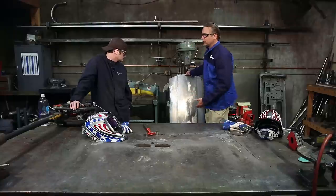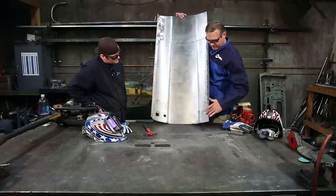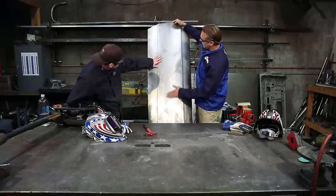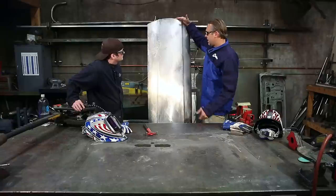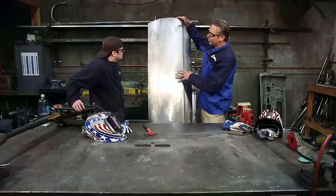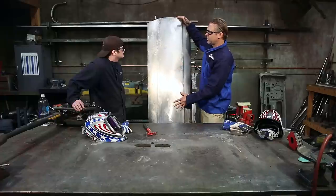Now that I've shown you the basics on TIG welding sheet metal, I'm going to show you a product that's almost finished so you can see what it turns into. Right here I've replaced a patch and done a big one here — straight as could be. It was dented and I knocked the dents out using a lot of heat. As you can see, the final product — you hardly even see the welds, you can't feel the seams whatsoever. This is basically just me knocking it down with a file and some sandpaper. I've got about 30 to 40 hours into it. The customer wants this door perfect — he doesn't want any Bondo and we're going to show the car in bare metal. I probably wouldn't take so much time if we were just going to slap a quick paint job on.